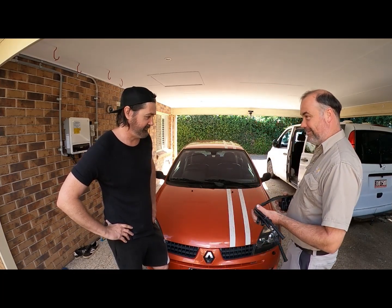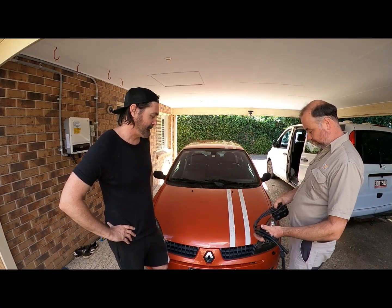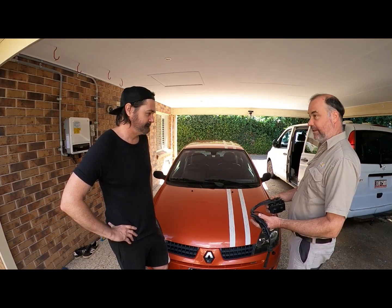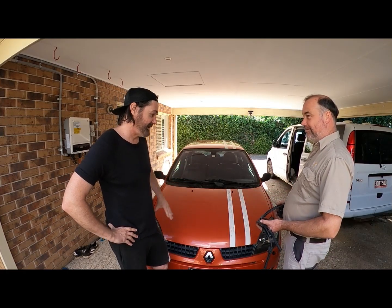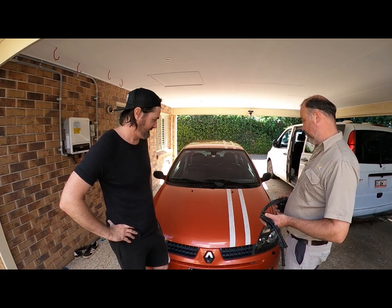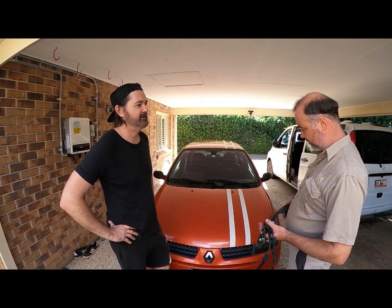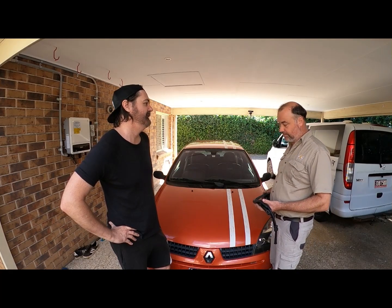Perfect, excellent. Because I wondered why you had the whole coil pack. Yeah, I just couldn't be bothered. You press them on, and it's all set up, ready for a 172. And it's the same as a 182, obviously. So we're just going to lift the manifold off, pop it on, away we go. And it's a bit of a tricky job, you were saying. It's not like plugs on another car. You're going to see why.